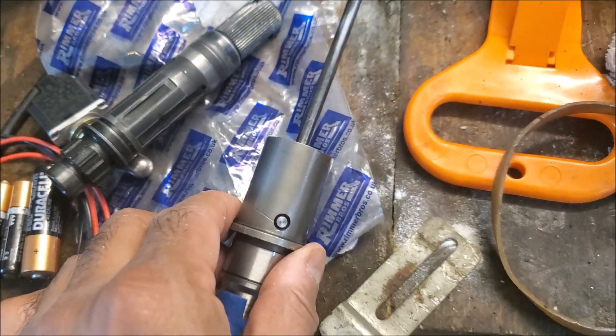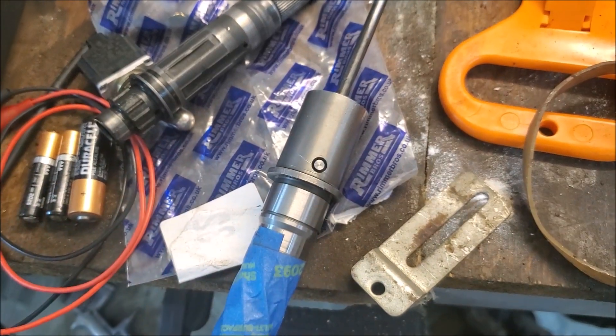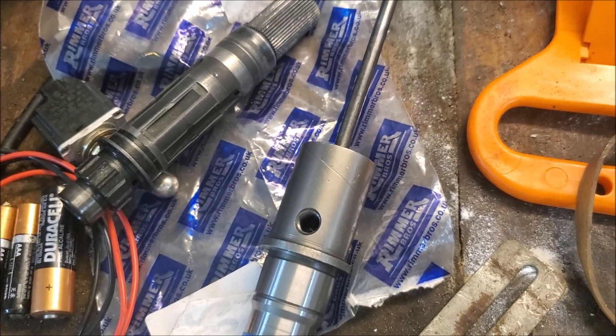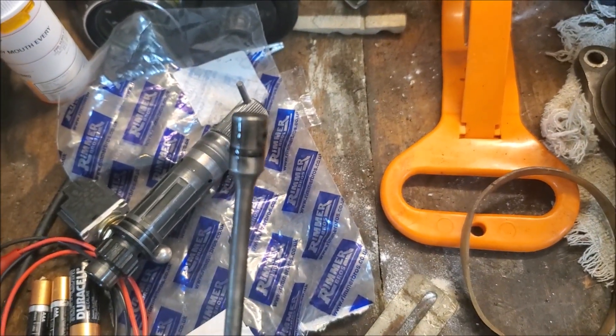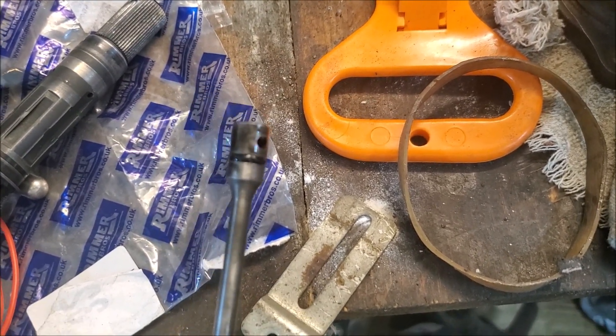Another thing — this is the earlier ADWEST control unit and it actually has a screw that screws into this thing here, and you adjust it. I have no clue how to adjust it, but maybe I'll rig up something and try and get it working. Basically this is the cause of that leak — it was the o-ring, or in this case the square ring, that was leaking through the control unit.